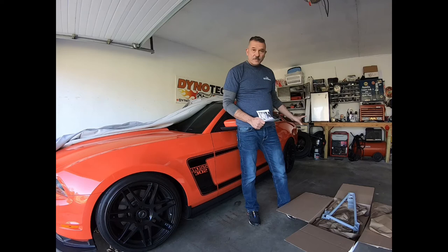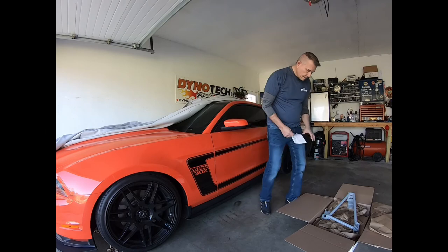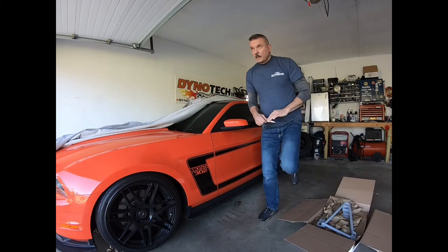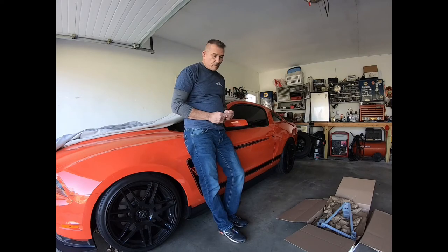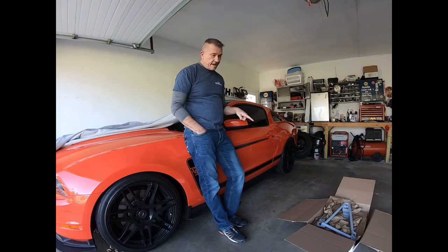After this, in the future we'll probably work on the front-end pieces. Now for the Boss owners, my understanding is that the side pipes — the quad exhaust — will need to be removed to add these, so I'm going to have to take those off and get them capped off. I do have an X-pipe on the car, and honestly I suspect I'll lose a little back pressure once they're capped off, but I think the car will actually scavenge exhaust much better because it's going to create a better vacuum. Anyways, that's what we have for today — like and subscribe, thanks and take care.